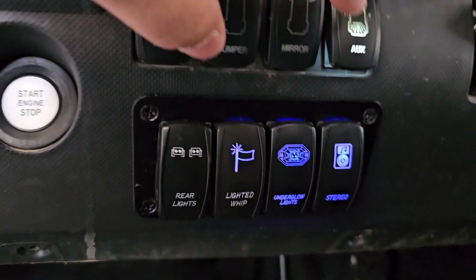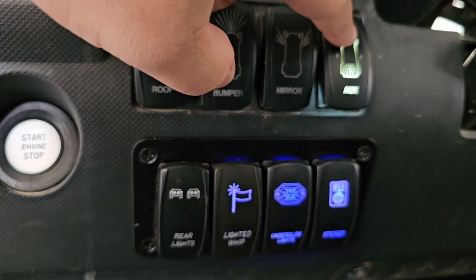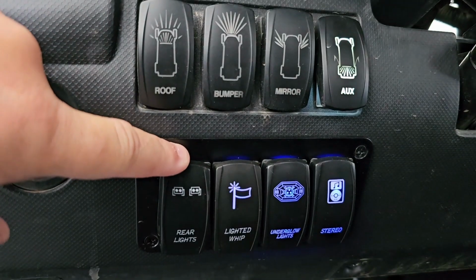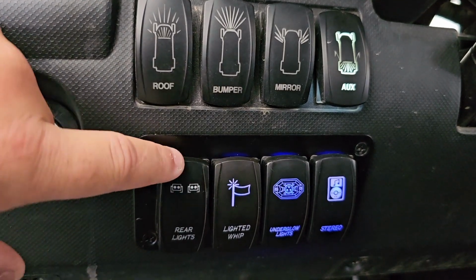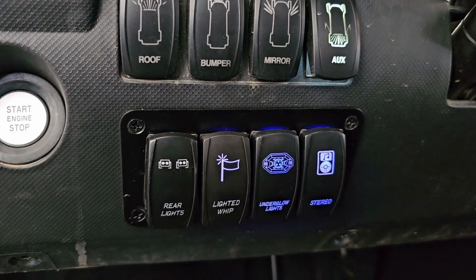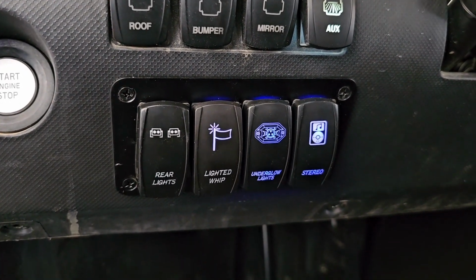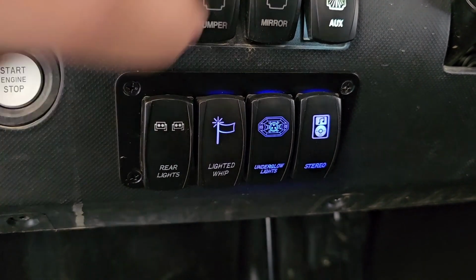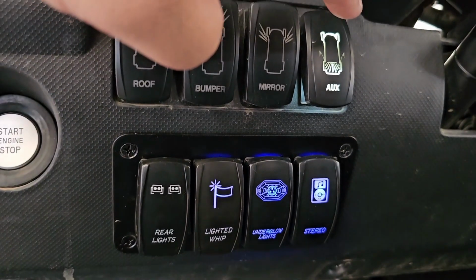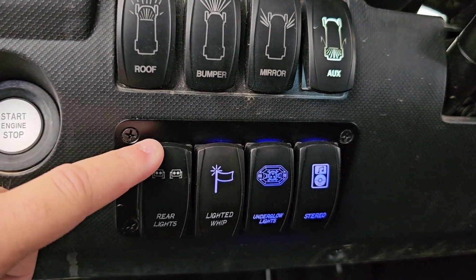So the main thing is that I took the aux one, which is now constant hot, and then basically once it's triggered, it lights the bus that basically will power all of these. If I'm not mistaken, the rear lights must have some type of relay or something like that. The reason why I assume that is because the wire going to it was pretty small, and based on what I assume the amount of amps are, I don't think the aux switch would have from the factory triggered that without a relay. So I assume there's already a relay somewhere in the back that triggers the chase lights.